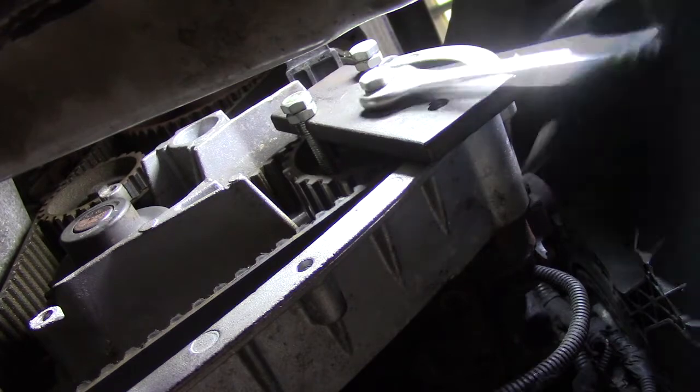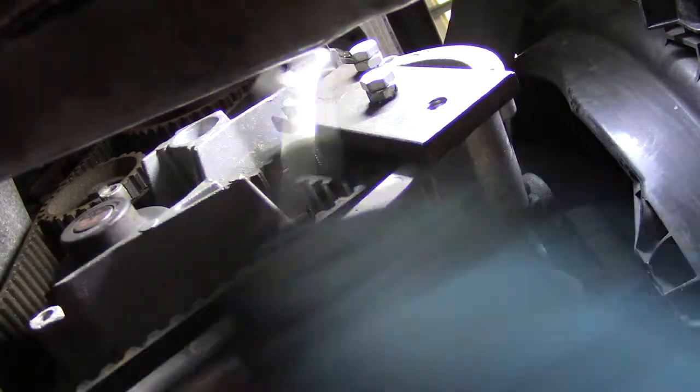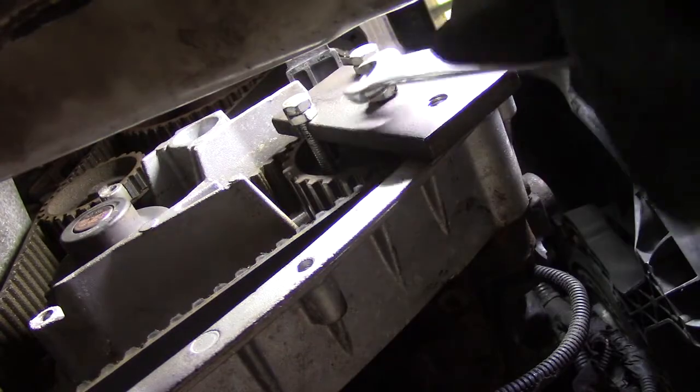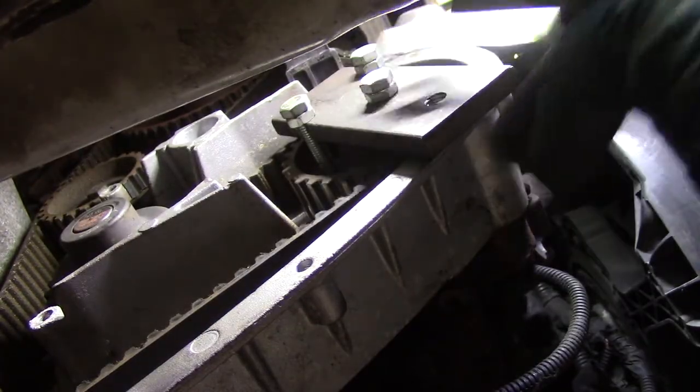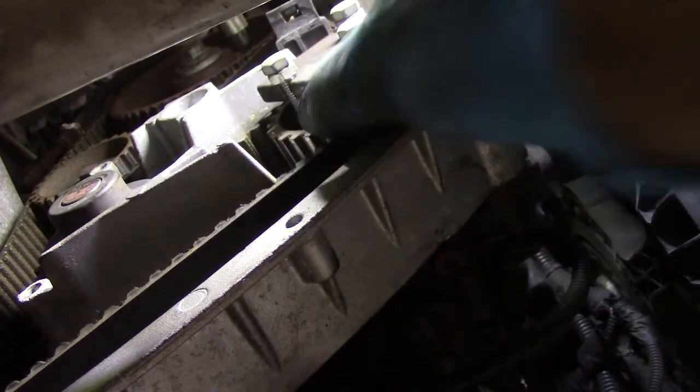and all I do is with a 13mm spanner tighten these bolts in progressively and evenly. Do this before you release the belt tensioner, because the tension of the belt will hold the pulley still while you tighten these up. And as you tighten them up, all it's doing is putting more and more pressure on that taper that the pulley is fixed on. And there we go. Sorry, I backed the camera. But the high pressure fuel pump pulley is now loose.